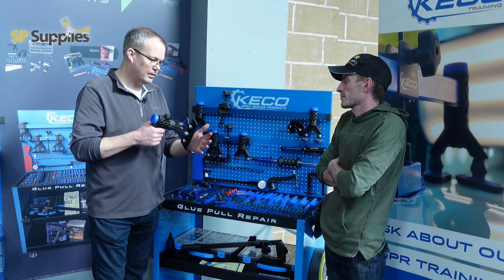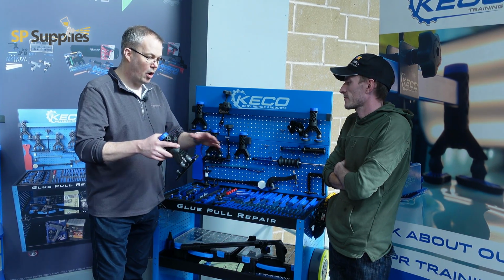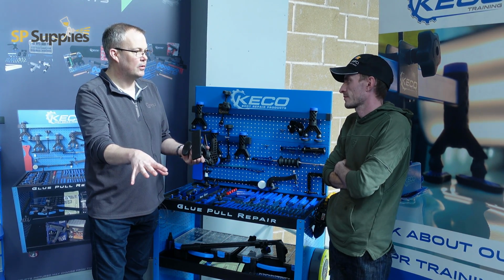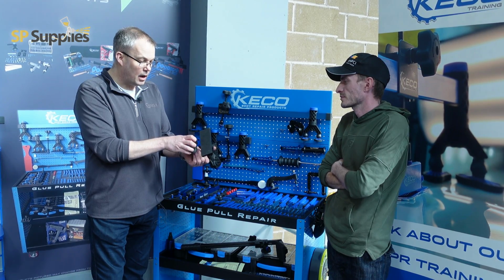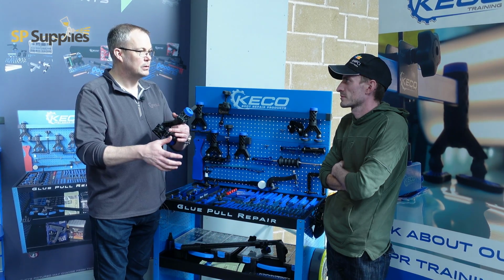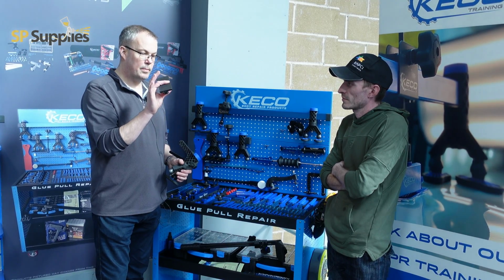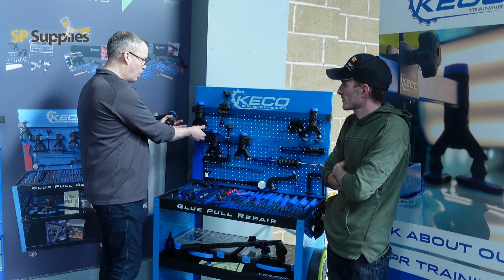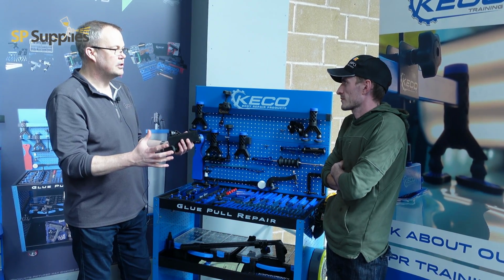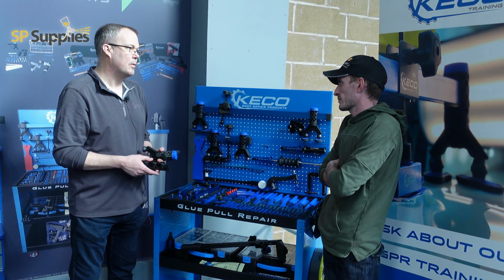We did it earlier where we had the K-beam on a panel, where we had the small kidney feet on the centre of the hood in the bonnet, and we would run the risk, if we were going quite crazy on there, that we could possibly put some collateral damage on the centre of the bonnet. So what we did, we popped off these feet and we put not just one, which we could have done, but we put one on each leg. So again, we're distributing that weight and that pull.